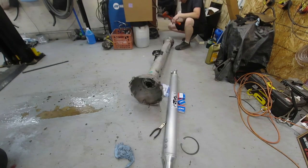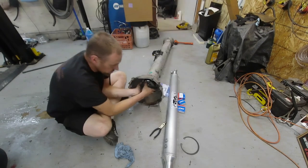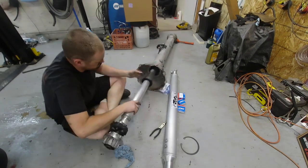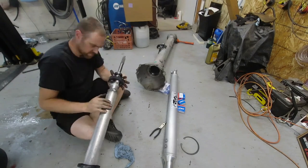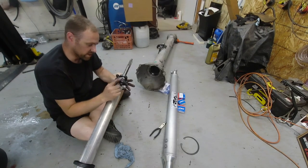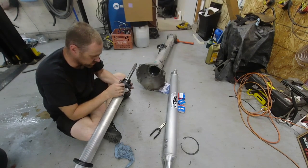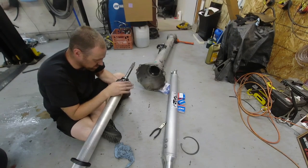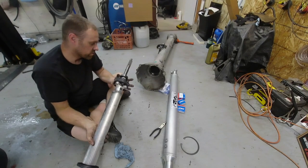Once you have that snap ring out, you can go to the other end with a rubber mallet and hit at the input shaft, then come back and pull everything out. The bushing is not torn — it does have a little bit of wear indication, maybe it was rubbing on the drive shaft or the inside of the torque tube. I'm not totally positive; it could have been from me pulling it out.